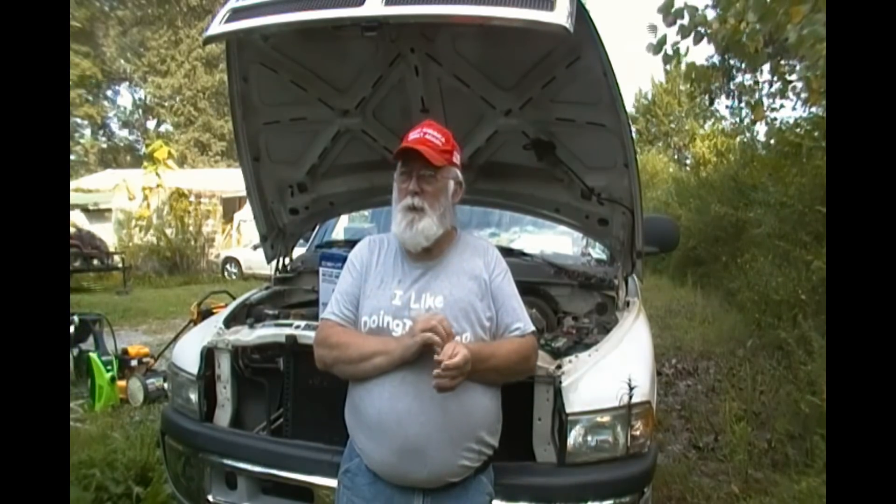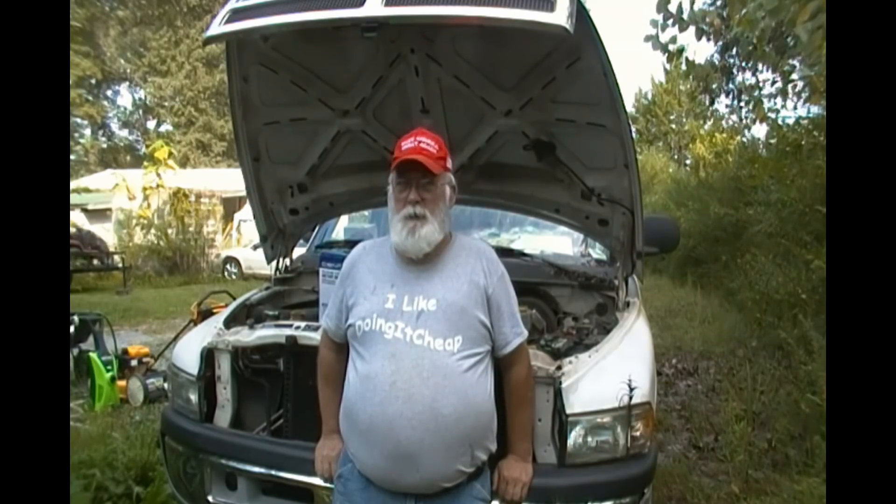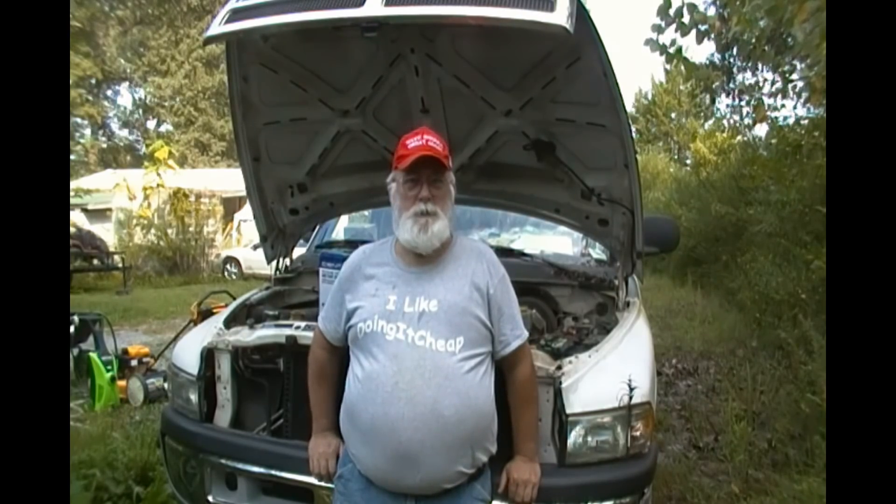A lot of my videos are very basic, and even those of you without any mechanical inclination can learn to do this. Here's the deal: I left the ignition switch in the on position and drained this battery. I believe my alternator is bad. I jump-started the truck with that little power box and it fired right up, but wouldn't stay running when I disconnected the battery pack. An alternator requires exciter voltage in order to function — it's not going to put out if you don't put in. It has to have voltage to excite the coils.